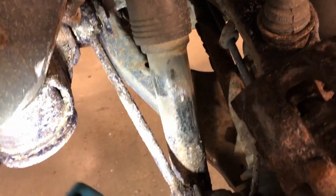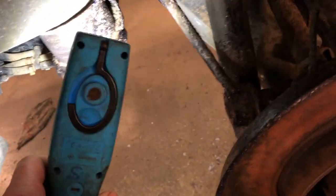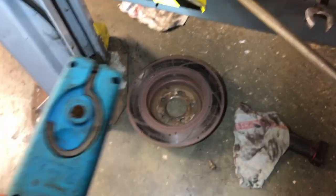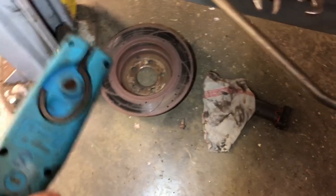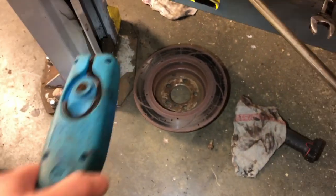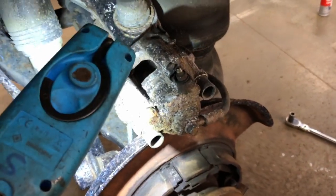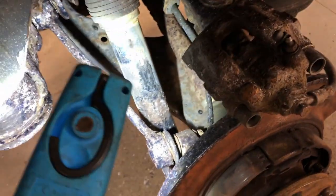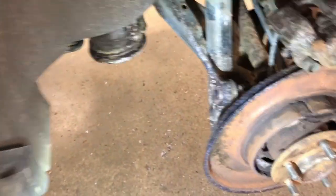You can see how it's all gone off — that's the Vactan rust treatment I'm using. I'm going to do the inside of the dust shield and the outside of the brake disc — matte black — and I'll do the shield matte black as well. I painted the caliper too, which I'm going to do matte black, and all of this I'm going to do in stone chip. I've also done some of the underneath.